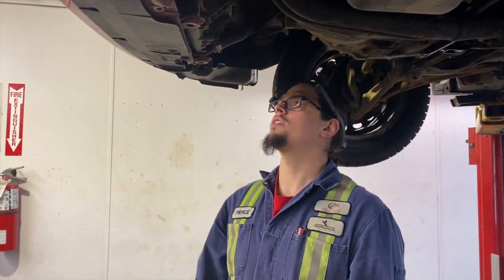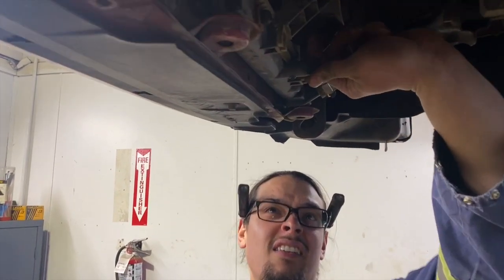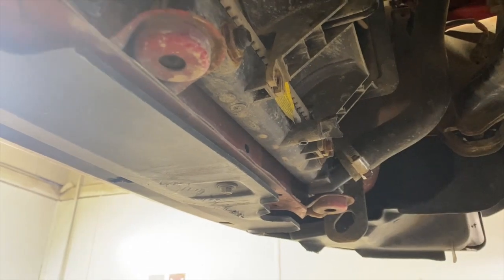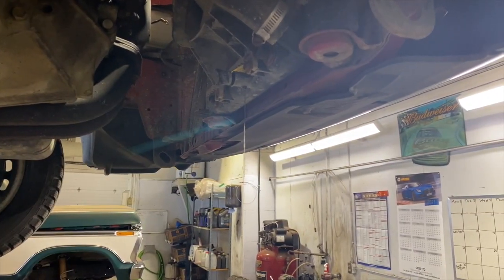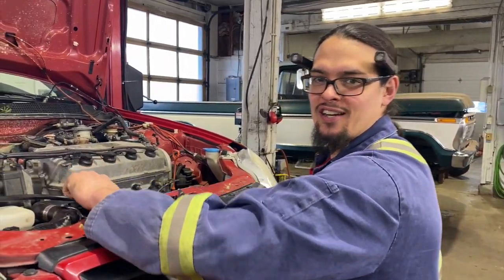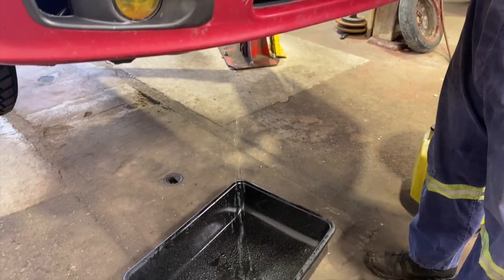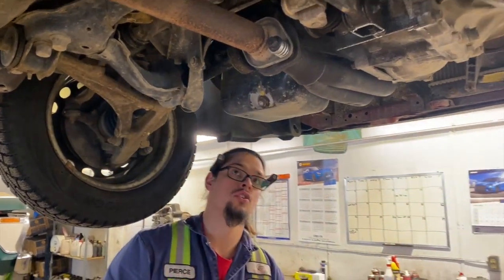We're going to start with a coolant drain. It just has like a petcock right here, and once you turn it out far enough, the stream comes out of there. Should have pulled the radiator cap off. Oops. Don't forget to take off your radiator cap or else you don't get flow. Oil cap can help also. Drain the engine oil.